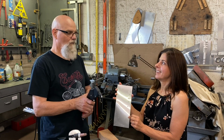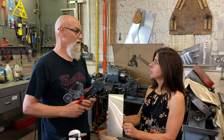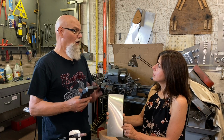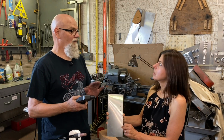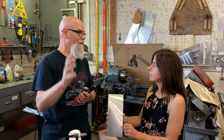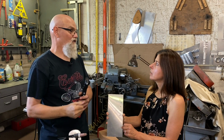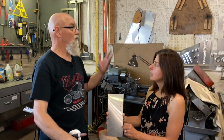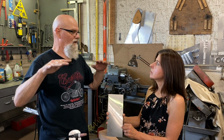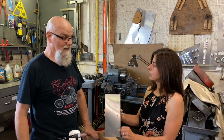The other nice thing about learning how to use this tool is that I've had an Airstream for 19 years, and all of my friends do the same thing, but we always have a rivet gun and a supply of rivets in the trailer, because as you're going on trips, you might have 1 or 2 pop out. If you don't get to them, a few more may pop out in the length of that trip. So the ideal thing is, you stop, say, oh, there's a rivet that's popped, let's fix it now. Then you're not putting undue strain on the adjacent rivets. So that's really useful.